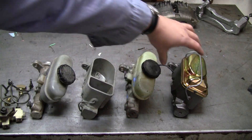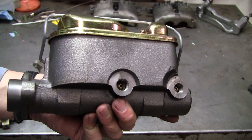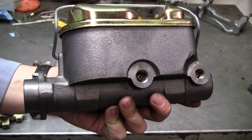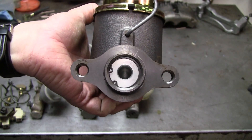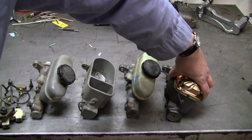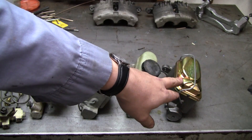The last one I have today is the heaviest, oldest, and biggest. It has a very large reservoir and is cast iron, although you may be able to get it in aluminum. Looking inside, you can see it uses an inverted flare with standard threads. This is the 84 to 86 SVO master cylinder — the bore size is one and one-eighth inch, the largest bore size, moving a lot of fluid. Ford used this on the SVOs because they had very large 73-millimeter piston calipers and rear disc brakes. It's a very oddball master cylinder; most people doing a conversion won't use it, but some may.